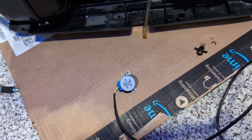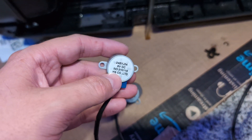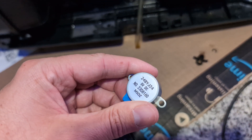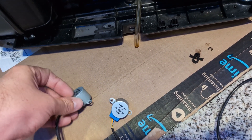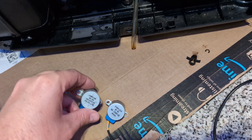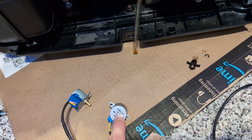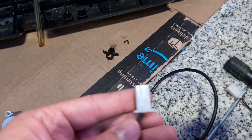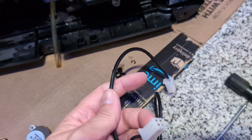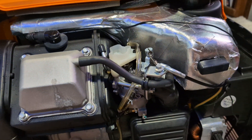Let's compare the new and old part and see if they match up. They look the same aside from the wire length, which shouldn't be a big deal. The original was HS Code Limited. The new one looks a bit cheaper — but we're going to give it a shot. It's the same model number, same voltage, the wiring colors are the same, and I checked the pinouts — those are identical as well. I'll just wrap up the extra wire somewhere in there and jam it back in to see what it does.